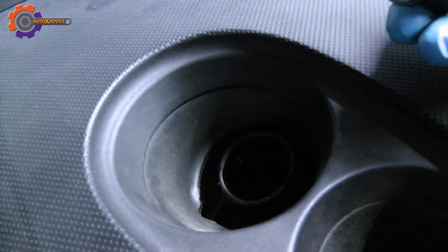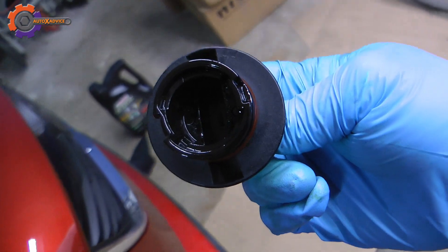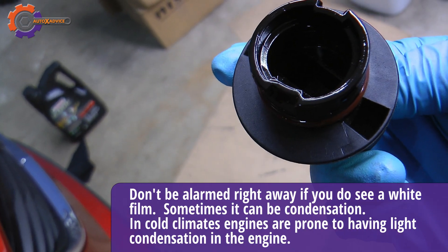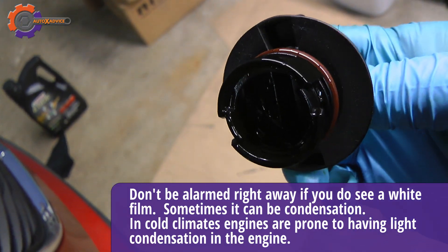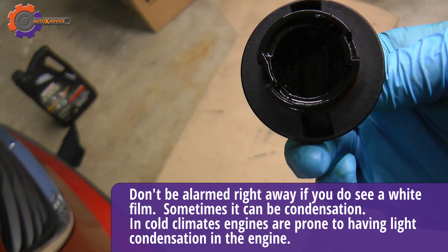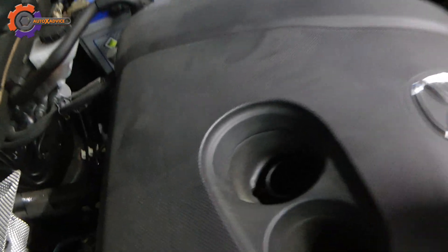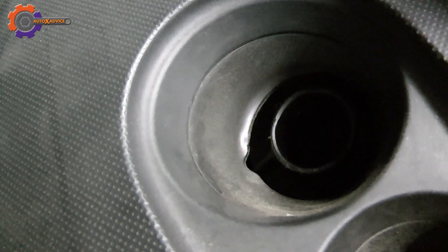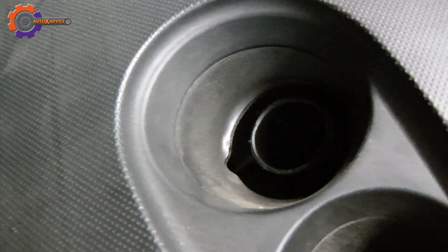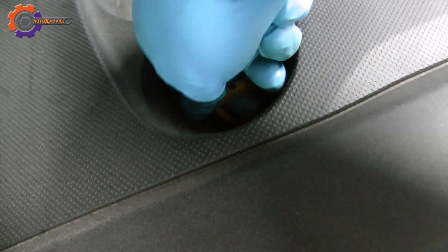The other thing you want to do is just look at the cap and make sure there's no white film in it. One of the other cars I had had an issue with a head gasket where the antifreeze got into the oil and it will foam up in this cap. You can check that — and this looks really good. Also take a look around the oil filler cap and make sure you don't see any debris or wetness. It's also a good idea to just pull your dipstick too — this is the oil dipstick you use to check your oil.